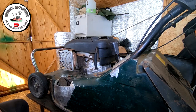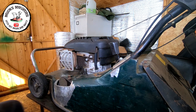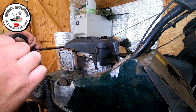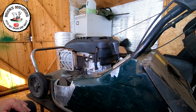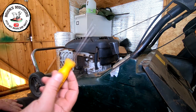The decision is the drive belt is no good — looking at the teeth on this, they look particularly blunt. I've got another belt here. This belt is brand new, never been used — it's up on my store. The belt number is 4887, which I got off eBay a little while ago for Hayters. I do also stock the Hayter 41 belts as well because they're common to go. So I've got a spare Hayter 56 belt.